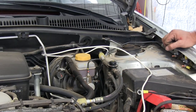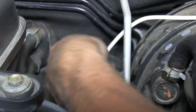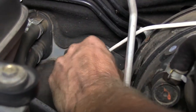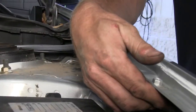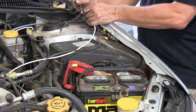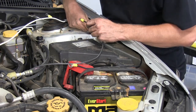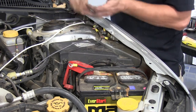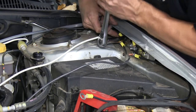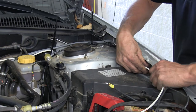We'll go ahead and take our white wire and run it to the inside. There's a grommet located right here — we'll take a knife, make a slit in it, and poke our wire through. We'll also take our leftover gray cable and run it through there as well. Once the wire is run inside and routed back to the battery, we can start working on our gray cable. We'll pull the sheath back on that one as well. The black wire will go through the 20-amp circuit breaker and onto the positive side of the battery; the other end will go to the brake controller. The white wire will run straight to the ground on the battery — the negative post. We'll finish off the ends but won't connect them to the battery yet. We'll take a few moments to zip tie the wires and secure them.